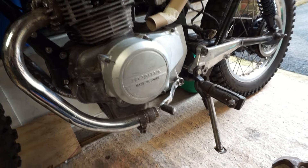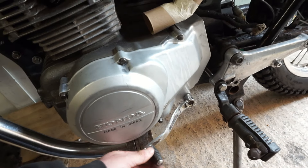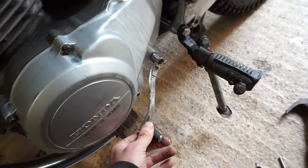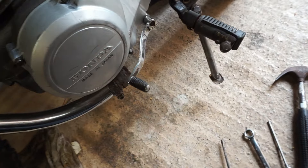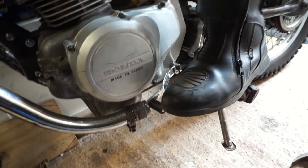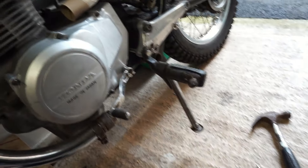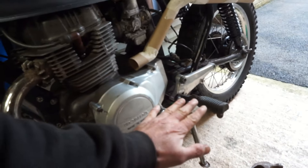Having bigged up the challenge of changing the profile of this, I just stuck it in a vice and pulled on it and it bent like it was made of butter. It now follows the contours of this quite nicely and gear changes work. The distance from the center of there to there is about 18 centimeters, so whilst it's not exactly what I was after, with my boot on it is perfectly acceptable. The challenge has simply gone back to the footrest, which is meant to be rotated up and around. Pausing on this for the moment — I think I've got a plan.